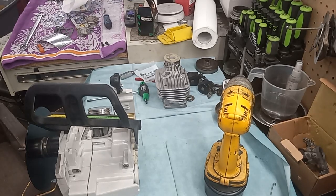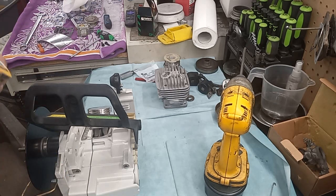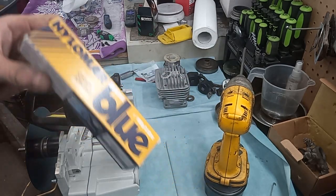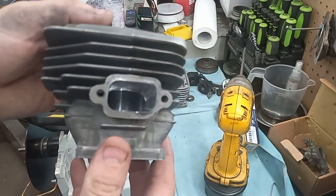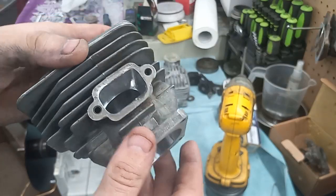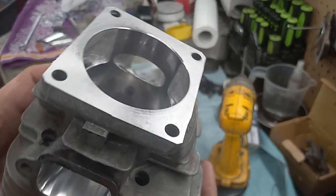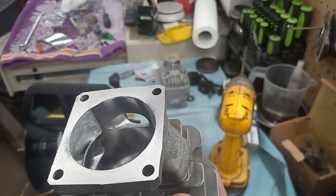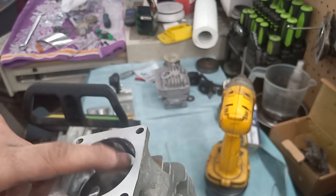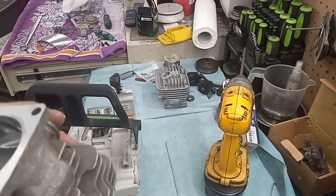Alrighty, guys. Ain't really been out here much today, but I'm gonna be trying this stuff for sealing on this. I've never used that before, but I've got the port work done. Here's the exhaust. Here's the uppers and the lowers. This intake was funky shape to begin with. Unless I go with a single ring piston, there's not much I can do about that. It's just where the pins and stuff end up being.